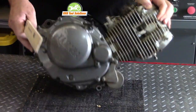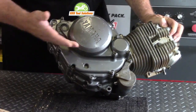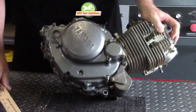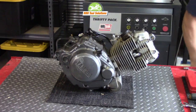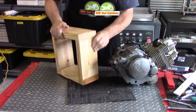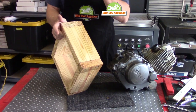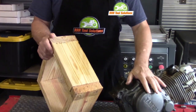The first thing we'll do is to measure the rough dimensions of the box we'll need to build. Measurements of our project engine revealed that the sides of the crankcase and the bottom would be well supported by having a box with a 10-inch opening in both directions. A square is the easiest to build, so the right choice for our 225 was the 10 by 10 box. Ours is built using 2 by 6 pine and 3-inch deck screws.